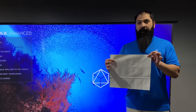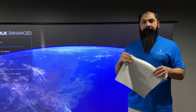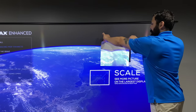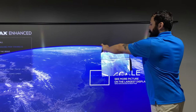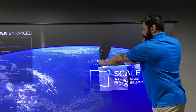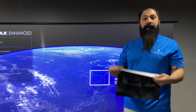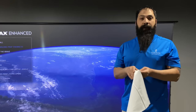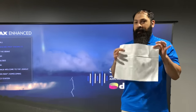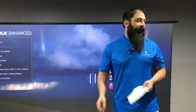Now this is just a standard white screen — nothing fancy about it. If we put light on this material, it doesn't necessarily look great. It looks really washed out in this environment. So that's the reason why, if you're going to have lights on, ALR is the way to go. If you don't want lights on and want to paint your room pitch black in a cave environment, white screen is the way to go.